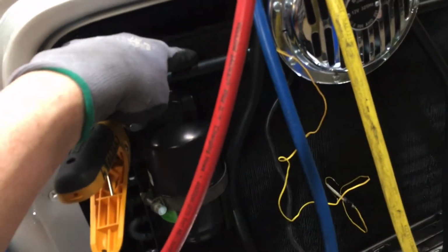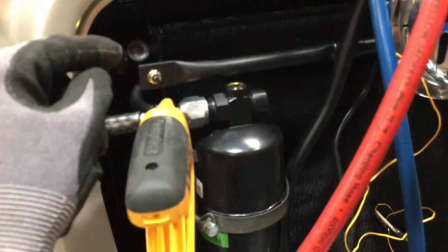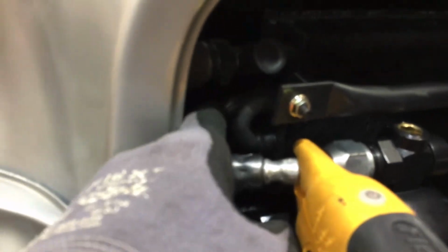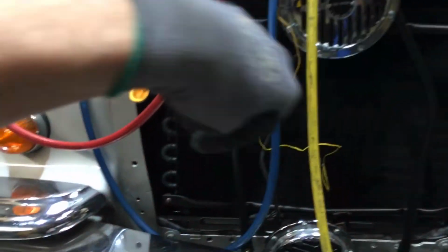Now, this is a tube and fin condenser. I talked about this in my parallel flow condenser video. This one is an indication of a parallel flow tube and fin serpentine type flow condenser. So you have our hot discharge gas coming in right here, and it's going into two parallel 3/8 inch size condenser lines. There's one in the back here and one in the front. This divides up into two, and they're literally traveling, and they're making a bend, and it's coming back this way, and it's making a bend. So you have two pipes, 1, 2, and it's just like a snake. That's why they call it serpentine. And it goes like this all the way down.